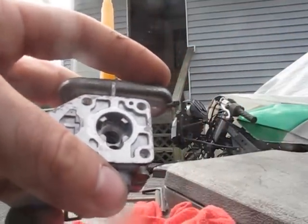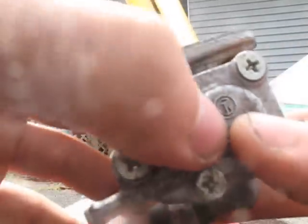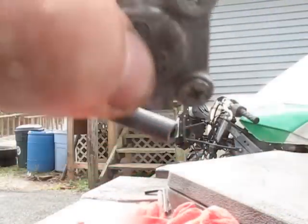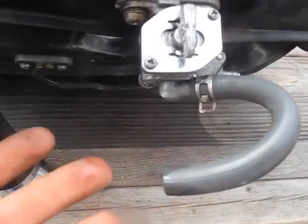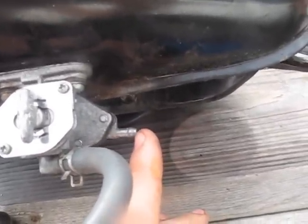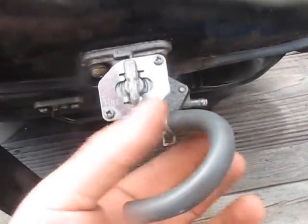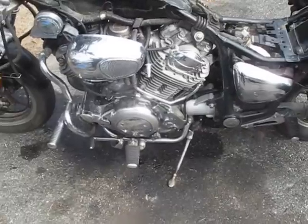Now I'm going to reassemble everything. Be sure that everything is reassembled and nice and tight, because if you have any vacuum leaks in here you're going to have major gas leakage and this valve isn't going to open when the engine turns on. So take real good care of those thin little gaskets and screw everything down properly. There you go — you can see that I am no longer dripping, so this repair did its job. Now I'm going to stick a hose on here and suck it with my mouth to open up that vacuum valve — and hopefully gas should come out, which means we're good to go. Last thing: be sure to change your oil because it's all contaminated with gas.